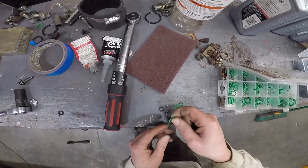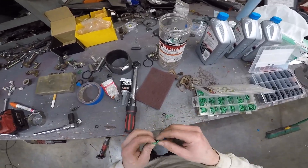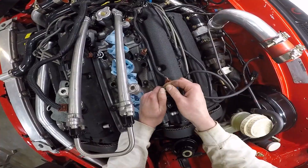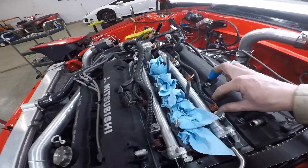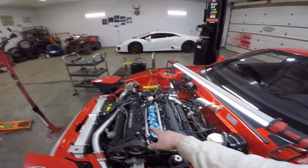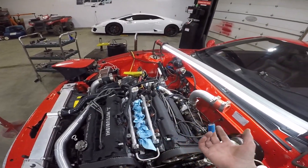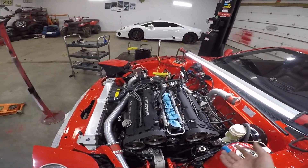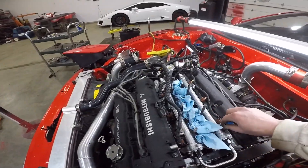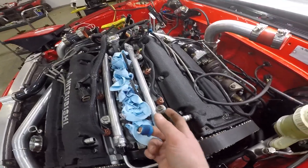The best thing I can do is go with this size — it's just a little bit thinner, not as thick, but the overall size is the same. I think I may have actually torqued this rail too hard. In my last video I was like 'I just torqued this to 11 because it went into aluminum and pretty much everything else that goes into aluminum on this car is 11.' I think that was too much because those O-rings were smushed. I got these snug and then did like a quarter turn to where they all met up with no gap.